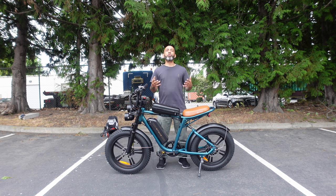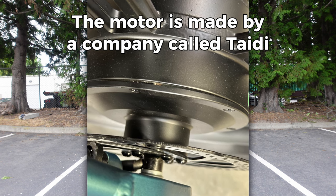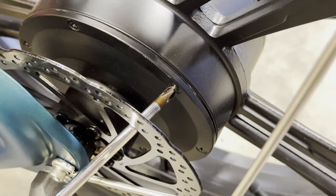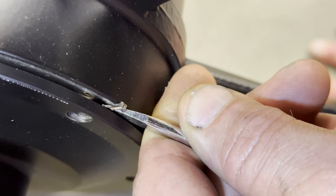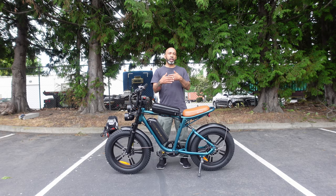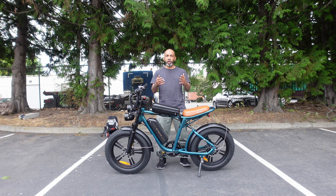Another thing to point out — and this is not a knock on Engwe because they don't produce their own motors — I noticed a gap in the motor along the cover plate. At first I thought it was an alignment pin crushed during assembly. My friend suggested taking the screws out, and yes, they were literally Phillips screws, not even bolts. I replaced those with M3 bolts to get the plate on there securely. Once we got the plate off, it turned out to be the tip of a tiny screwdriver that had broken off and got wedged between the motor housing and the motor plate. This could have allowed water and condensation to get into the motor and cause premature wear and damage. Definitely check your bike over thoroughly when you get any e-bike.